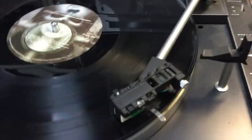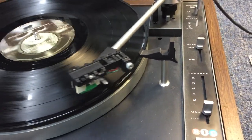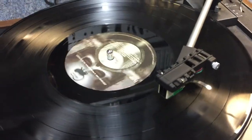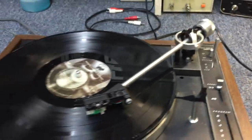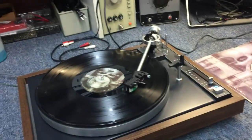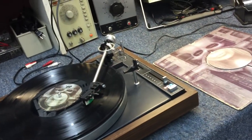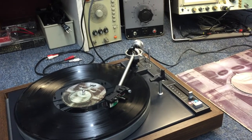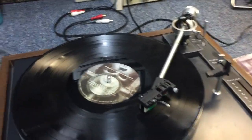Although I did notice that we do have some issues with the automatic functions. What it will do is start over again, but only for a 45, not for a long play album — then it goes to off and shuts down. So I'm sure we have some gunked-up things underneath the bottom of it. Let's get the platter back off, take off that substitute belt, remove the headshell while we're working on this so we don't damage that cartridge, then turn it over and see what we can spot underneath — maybe some gunked-up levers causing issues with the automatic functions.